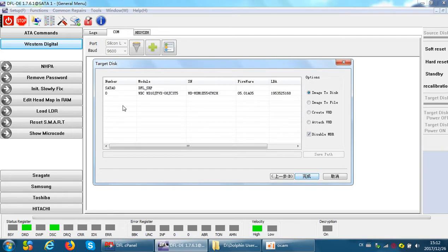Next, we need to select the target disk. After the disk image, the target disk will have exactly the same contents. If the source drive has a good operating system without damage, then the target drive can be used as a bootable drive as well — we can simply connect the target drive to the computer and it will boot up normally. Now let's check the next step.